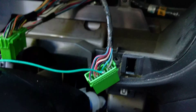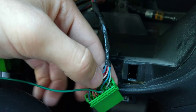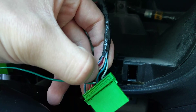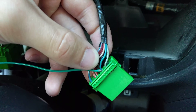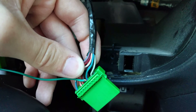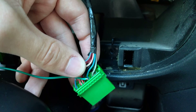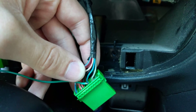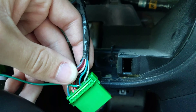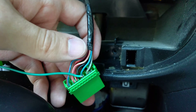Right here you can see the green wire from the AEM coming in and joining with this wire right here. It looks a bit blue on camera due to white balance, but it's a pretty blue wire with the faintest green stripe you've ever seen. This is your tachometer signal. It's a digital square wave RPM signal — not analog — which is why it works with the AEM.